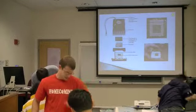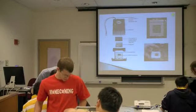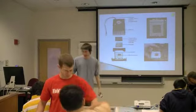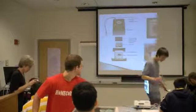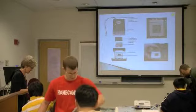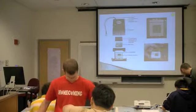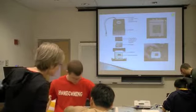Awesome. So did you line up the arrow? Yeah, sometimes you're in. So go ahead and close the socket once you're ready, just by pulling the lever back into place, and it should click. Oh, the last slide was a newer one. Okay. On the newer ones, it has a piece of metal that comes over the lever, and then you want to place the processor. It's already open.